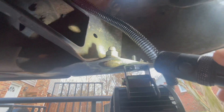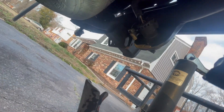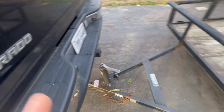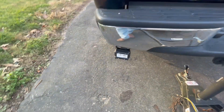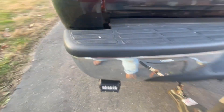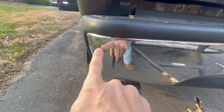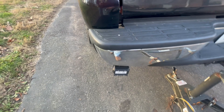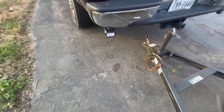This is tied in — I drilled a hole and put the bolt through that came with the lights. My other one runs over and does the same thing on the other side. A lot of guys are starting to mount them up here at the hitch, but I don't like that because you're just lighting up your tail hitch. I put them down here, and I like these because you can turn them out and have them shine exactly where you want. You can't really do that if you mount them at the hitch because the inner support bracket is right there. If I did mount them up higher, I would cut it out and put it there because it looks like a better finish — but that's completely useless for me since I just want to see the curb and light things up. That's the whole purpose.